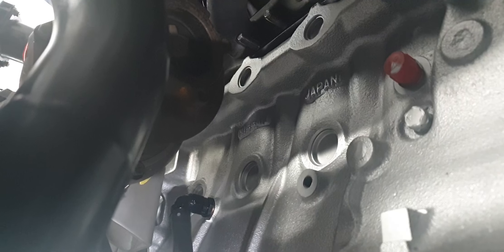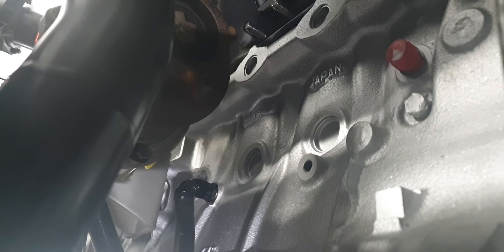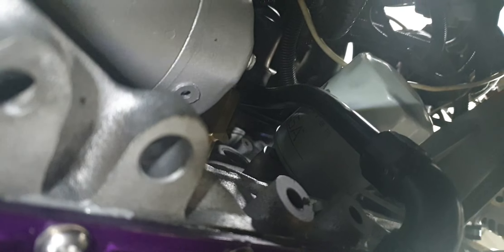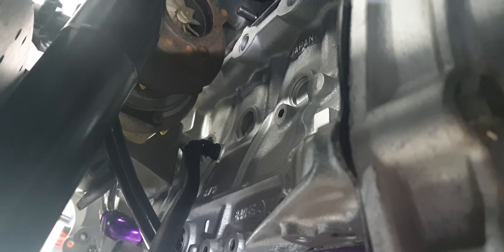She's pushing — that's about 40 pound oil pressure there. It'll do this for a couple of minutes now until it pushes all the oil out of the journals.